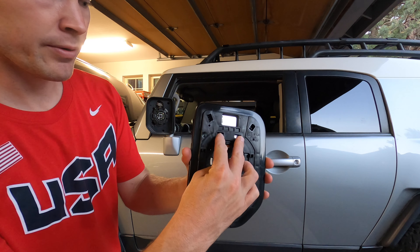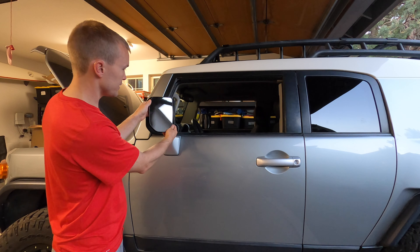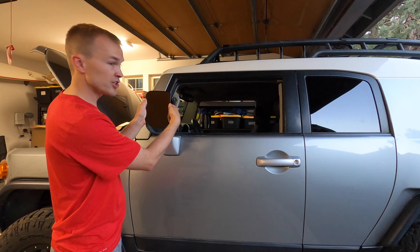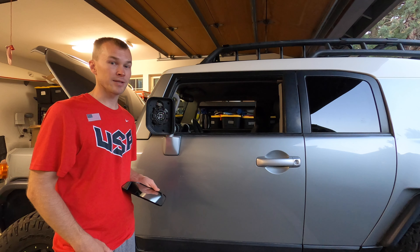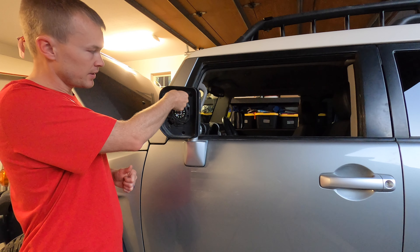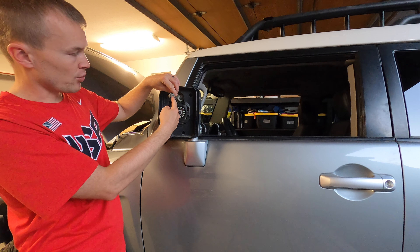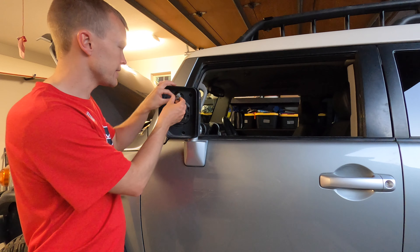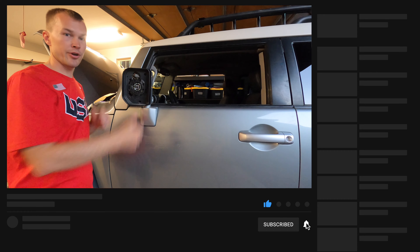You'll see on the backside it's got these two little clips right here. Those clips slide into these little points here. To remove this, you basically want to take the mirror, push in the top and pull out on the bottom, and then just yank it off. On the passenger side it came off no problem; driver's side I shattered it, so just be careful. Now if you're just wanting to replace your burnt out bulb, all you've got to do is take this little light bulb, twist it counterclockwise, pull it out. You'll see you've got the bulb — just put your fingers on that and pop it out. You can pop a new one right back in — super easy. Then reinsert it, twist clockwise, and put your glass back on.